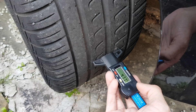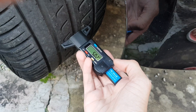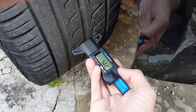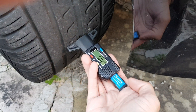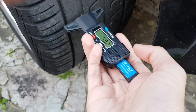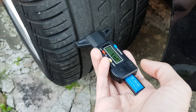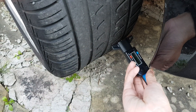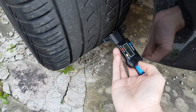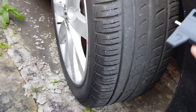Push until it hits the edge — and there you go. Mine is 4.86 millimeters, so about five millimeters, which is plenty above the 1.6 minimum. All you do is push it until it seats, and you'll feel it. This edge section reads 5.4, and the other edge reads 6.2 millimeters because it's not worn as much.